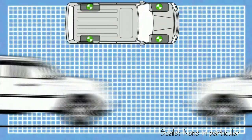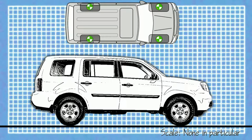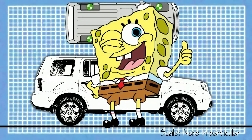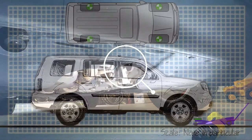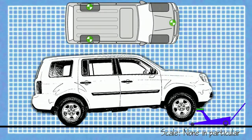Since I'm not going to destabilize our primary family vehicle on purpose, not even for social media hits, let's try an illustration. Here is the vehicle sitting on the ground, taking advantage of one of nature's simplest stable shapes — a rectangle. Four tires, four points of contact, won't do anything unless acted upon by a dramatic force. So let's introduce one in the form of a hydraulic floor jack. We have a rated lifting point under the front of the engine subframe, and this is a safe place to lift this vehicle. The goal is only to get the tires off the ground, not to lift as high as possible.